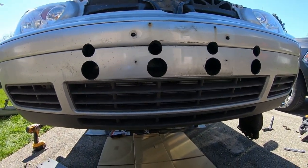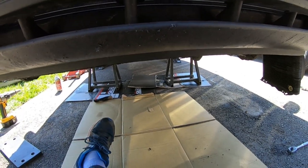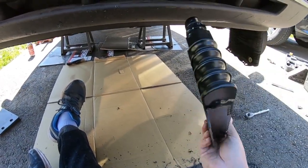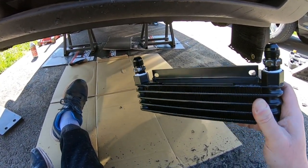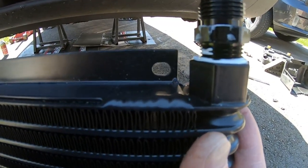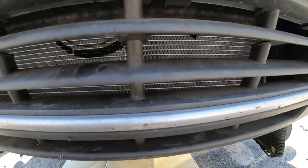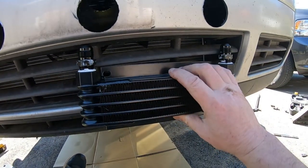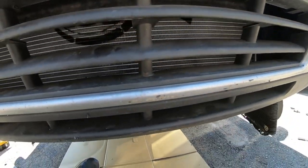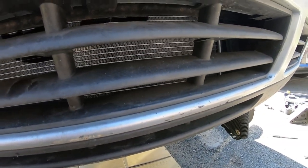So now we're going to move the oil cooler, and I don't think it's going to fit where I originally wanted. I went out and bought this little Derale oil cooler - the boys at Performance Improvements had it in stock. I already put in our half-inch MPT to dash-10 AN adapters with pipe dope. This is going to sit on the inside of the lower grille area. We'll take the bumper back off, take measurements, get the welder out, make two metal bars to bolt it in, and extend our lines as needed.